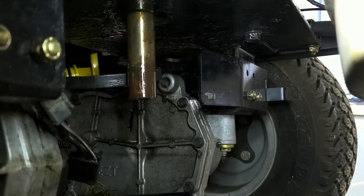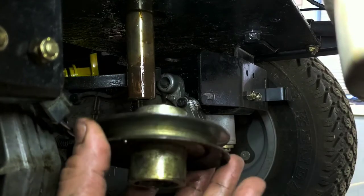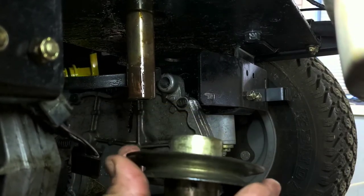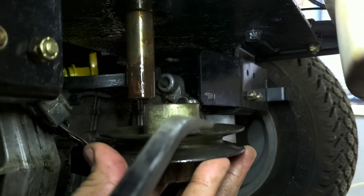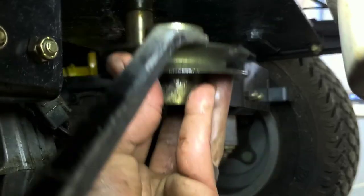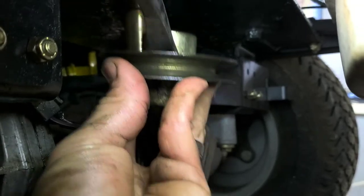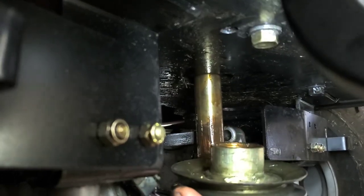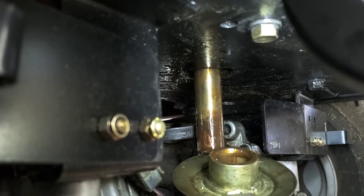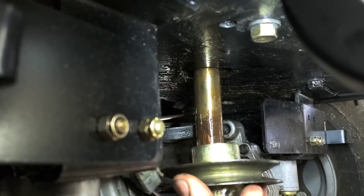Now, when I say that, I don't mean go get a 6 foot pry bar and start ruining everything in sight, because this metal here is very, very weak. So it will withstand not very much pry force. So what I like to do is get a pry bar, something like this. And so this is up in here, and you want to just kind of pry against the top of the frame and then as far in on the pulley as you can get. So as you're prying, you'll be prying actually up here, way at the front, against the shaft. And then you'll be at the top here,